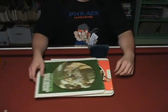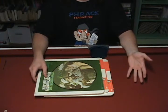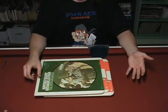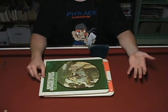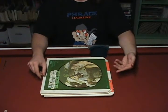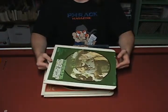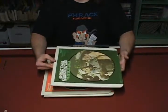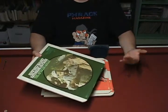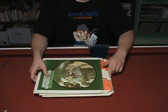You're also talking about a time when VHS and Betamax were just coming out — consumer-friendly, inexpensive, you could record a lot on them, and you didn't have to change tapes. You also had laser discs, which are like giant CDs — they could have much more content, different audio tracks, and digital data, whereas CEDs are just analog. There was also the problem of disc condition: RCA stated video discs only last ideally about 500 plays, whereas a laser disc can have an infinite number of plays. Dust gets onto the surface and causes skipping, the stylus wears out and needs replacing, and these parts are harder and harder to find, so the odds of finding a working SelectaVision are pretty slim unless you're willing to pay a lot.